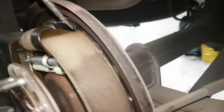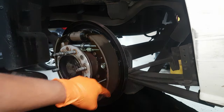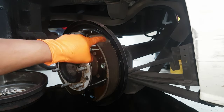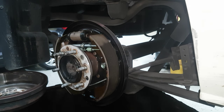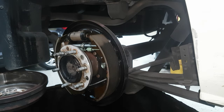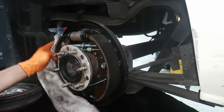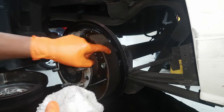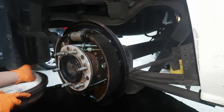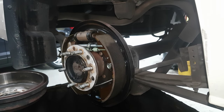I spray on the back contact points on both sides. Make sure don't spray the brake shoes because oil is a lubricant and it will not hold the brakes properly if contaminated. If it happens accidentally, just clean it up with the brake cleaner. Also make sure the brake drum is clean — no more dust or oil.